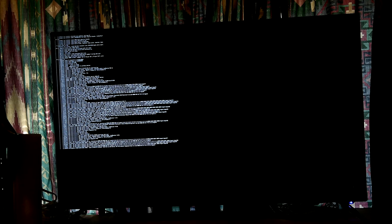I don't want to just hurry up and read. Well, I can't do Control Alt Delete anyway. I think we have a bad kernel update. Coincidentally, about 30 minutes before this happened, I had rebooted it, and it showed up like 9 updates. Most of it was a couple of extraneous updates of regular programs, but the kernel could be one of those. Usually if anything's going to stop anything, it's going to be a kernel update.